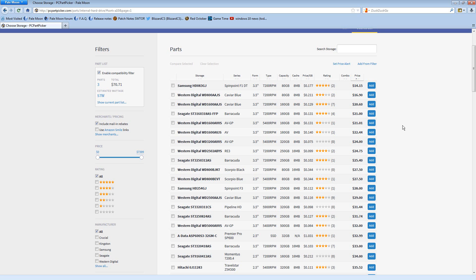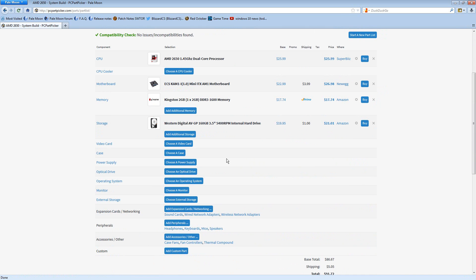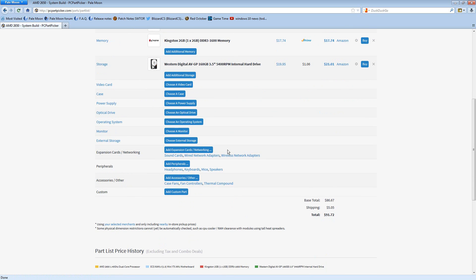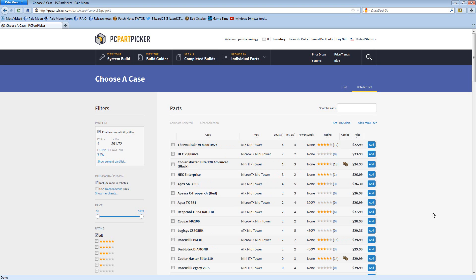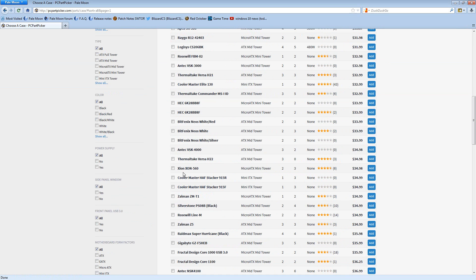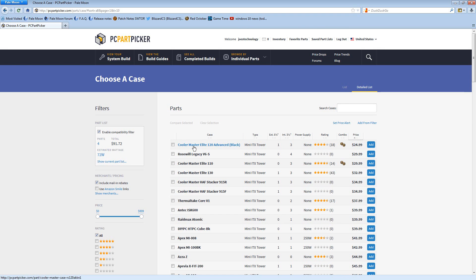Western Digital makes some great drives, so we'll go ahead and pick this one — it's 5400 RPM and 160 gigs. Of course, if you needed more storage you could choose a different one. And similarly on the processor, if you felt two cores wasn't enough and you wanted four cores, you could substitute the Sempron 3850 or the Athlon 5150 for more power overall. There are lots of good choices. Since we're looking at a Mini-ITX build, we want to filter the cases so we don't have a huge empty case — you saw how small that motherboard is. So filtering by Mini-ITX gives us the Cooler Master Elite 120 Advanced. This is actually a nice little case.